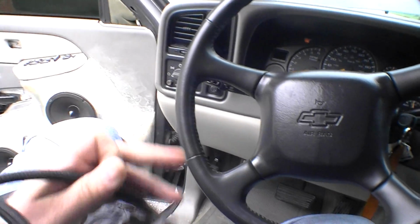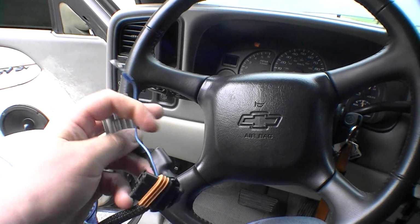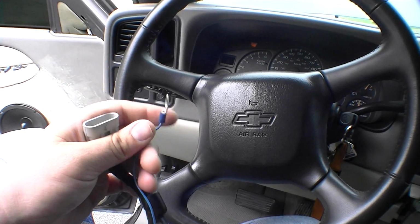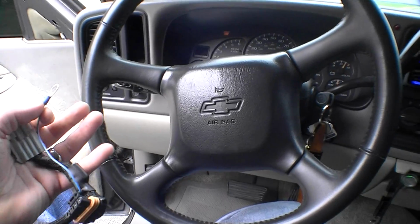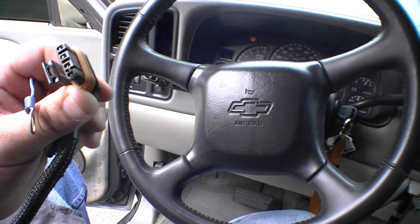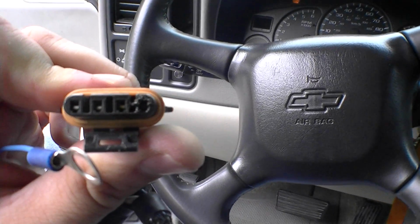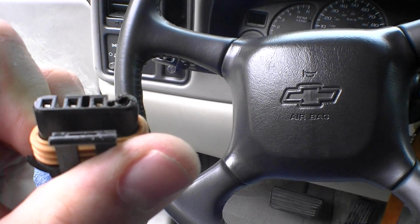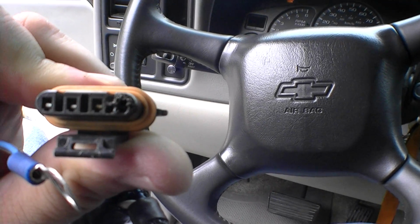I mean, like I said, I got one harness here. Worked awesome when I had, you know, this big gray port goes to your stock plug. This goes to the 12 volt post on your alternator, or just a 12 volt constant should work fine. And then this went to my first alternator. You can look at this one actually and see that when I hooked that second alternator up, it got that wire so hot that it actually caused some damage on the first alternator side.